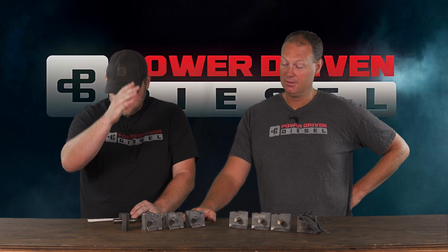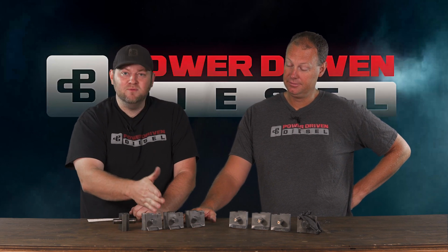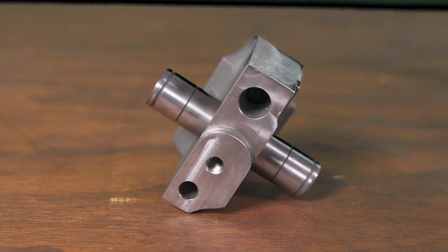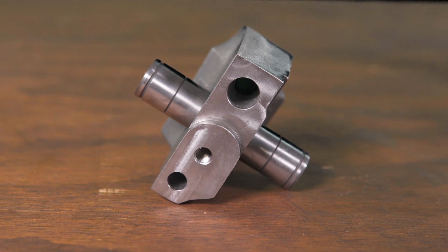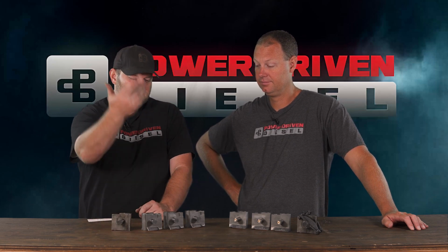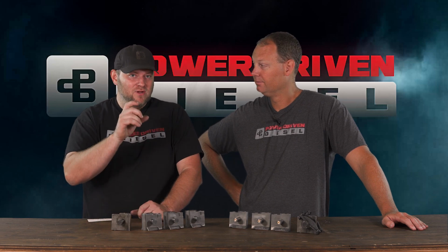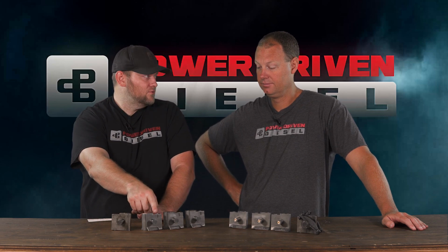Anyway. These are awesome. Oh, they're pre-machined for head studs. So a lot of guys are sending in your pedestals, and machine shops charge you a couple hundred dollars to cut a relief in there just to run your head studs. These are set up for it already. If you don't have head studs, the factory threads on your head bolt are long enough. You could still run a head bolt on here.